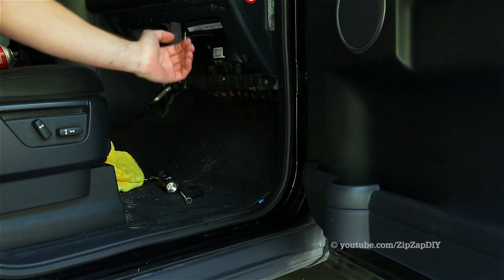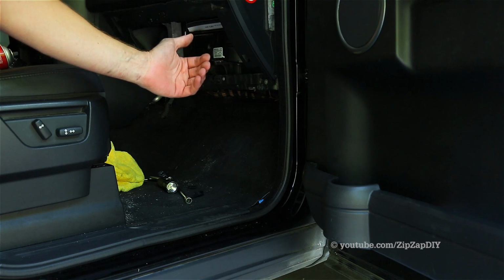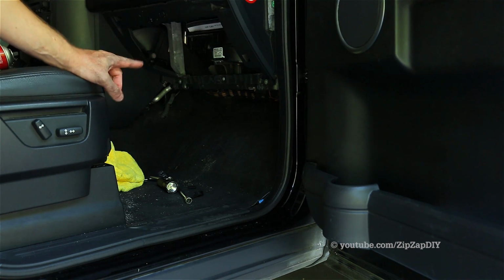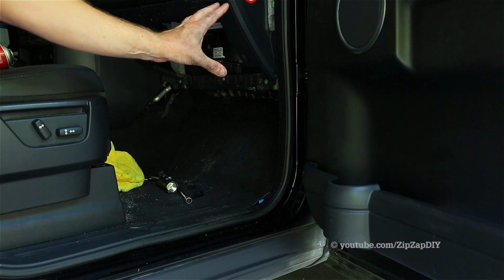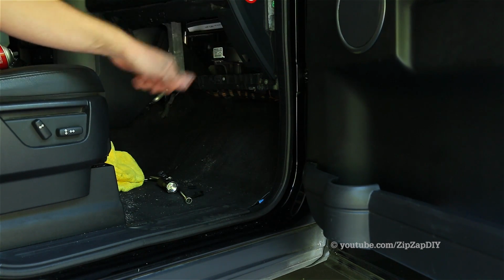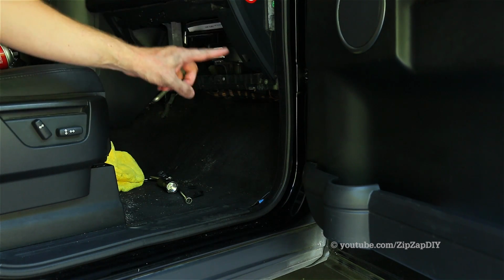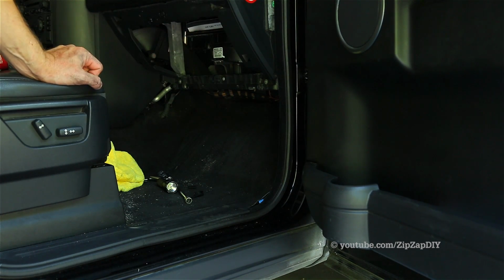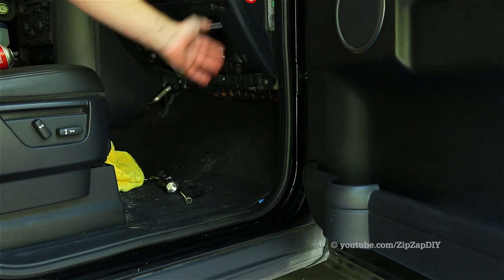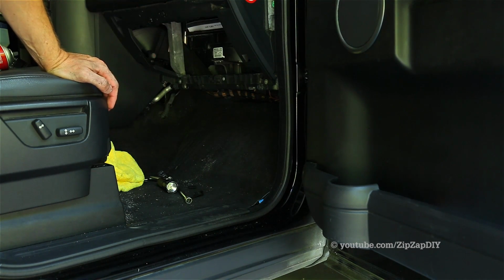The connectors on the back side of it, you want to do those first. Those are the most difficult, and they are terrible. The ones up front, you want to put those on kind of all at the same time. You kind of want to wiggle them up, get them on, snap them in, and then bolt it down. Do not bolt the CJB down first. All I have left to do is to install the glove box, put the panels back on, and then I am good to go.